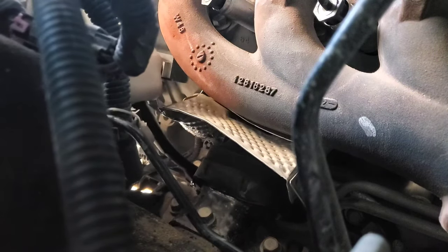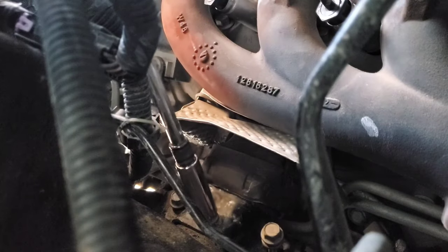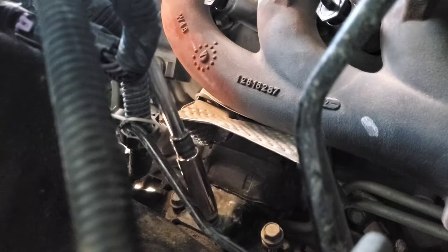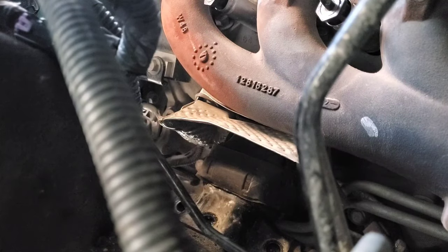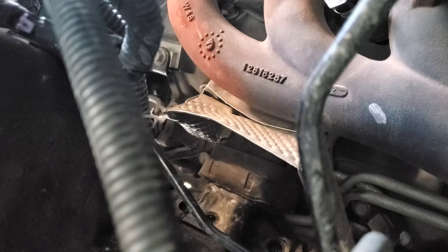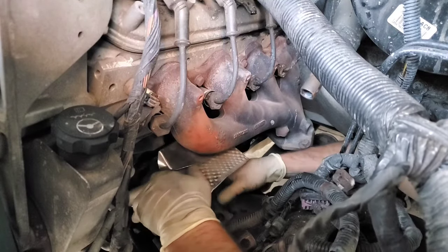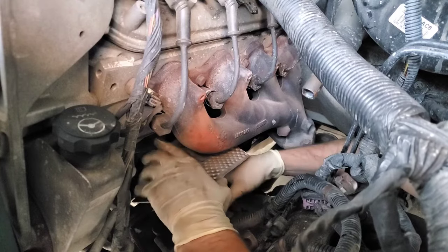You can scoot in here with your ratchet and get the rest of these bolts out — four on the block side and then the three right there on the frame side. Those three are real easy to get to after the steering intermediate shaft has been removed. You could get these out with the intermediate shaft there, but then you wouldn't be able to scoot the engine mount out. There's the frame bolts. Go ahead and raise the engine up with your jack now — don't be shy, you can go a little higher with it. This is where I got a little bit fiddly with the engine mount — I thought maybe I could prop it out of the way and keep it up high enough where I could scoot the oil line past it. Nope, that didn't work. You do have to remove this completely for the clearance.